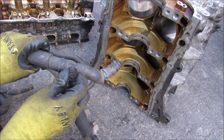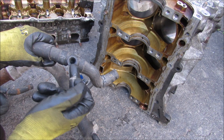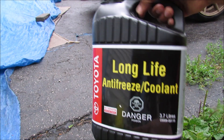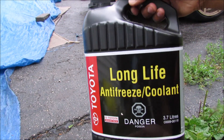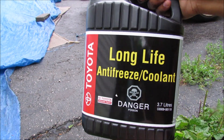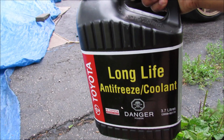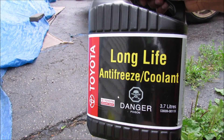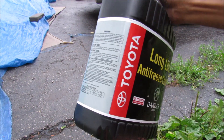This little cap on the hose going to the heater core is just for air bleeding, as it's the highest point in the system. The purpose of engine coolant is to raise the boiling point and lower the freezing point of your car's coolant, because normal engines operate in a wider temperature band than just normal water itself. It's also based on ethylene glycol, which is great for preventing corrosion inside of your engine.